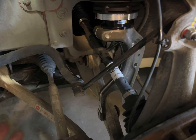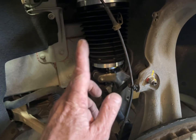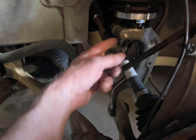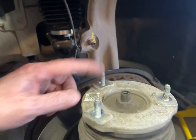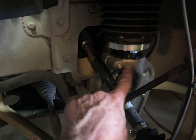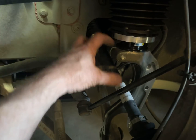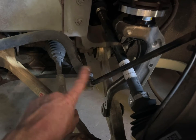One thing I wanted to make on the video: it's just me — there's nobody else helping me. So as a one-man crew, the way I figured out to get it up in there was taking this upper control arm, moving it to the side, which took the CV axle pressure off of the strut. I moved that over, and then with my body physically in here I looked for the holes, lined the holes up with these three screws, and kind of slid it up in there. Made sure this was in the right position, cause this control arm has got to go through there — you don't want it turned around the other way, cause then it's going to run into your sway bar link on your sway bar.